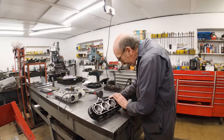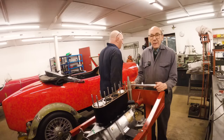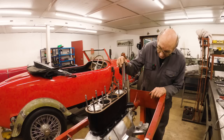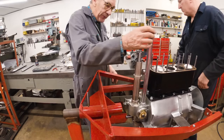Now, we've got this. So we need to put the filler tube on. Again, this is a part we didn't have, because there's a little drain on the cylinder head that drains down into here, and we didn't have this. In fact, we didn't even know what it looked like. So we looked at the Portugal car, and it's absolutely original, and that is how it looks. So we copied that exactly, and that goes in there like that. And then when you put the head on, you have to guide that little drain pipe into that hole. So if you take the head, John, I'll make sure I'm here to...